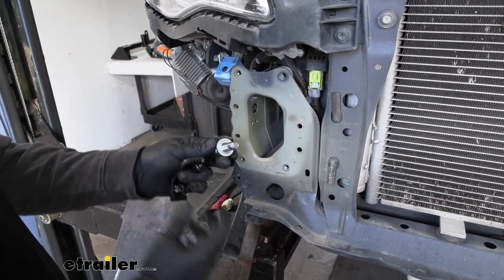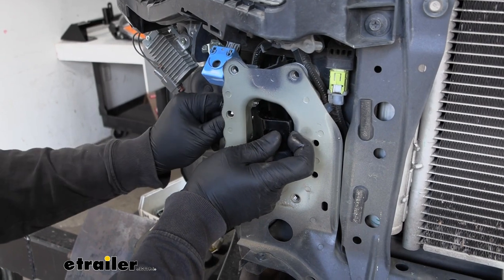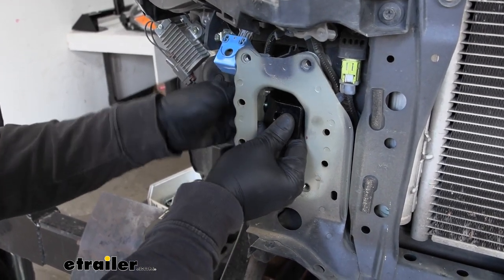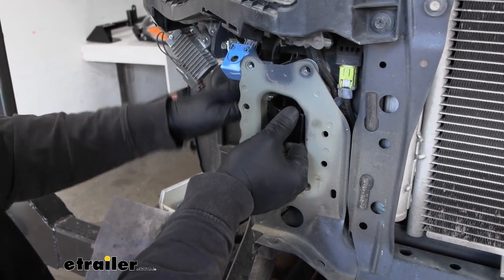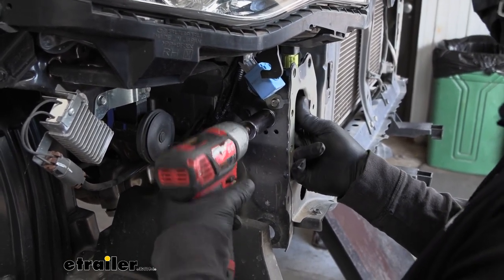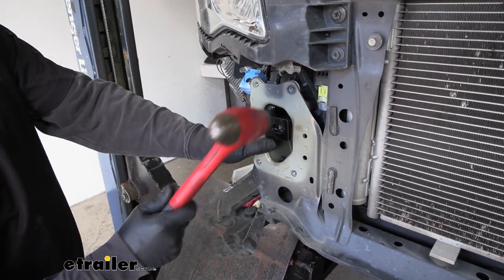You don't need to go too heavy on it. Take your bolt, put that through, and get it started hand tight. When we tighten this down, you want this to sit as flush as possible with the frame. If it doesn't, not really a big deal — we can tighten it down and come back with a hammer and tap it in a little bit if need be. Hold it as straight as you can and come back with a 19 or three-quarter inch socket and snug it down. If it comes out just a hair past the flange, give it a little tap with a hammer until it sits a little more flush.